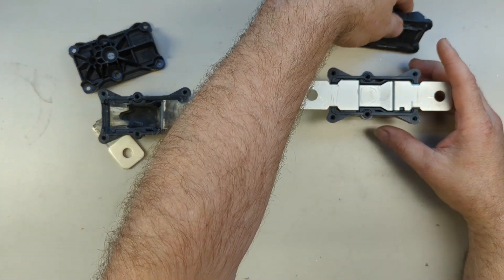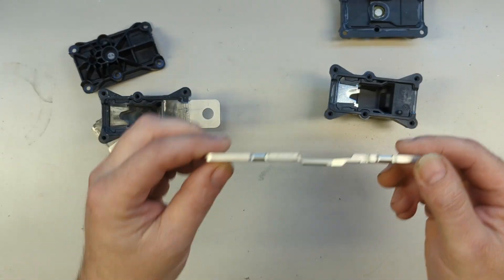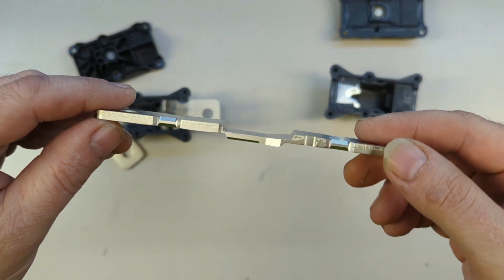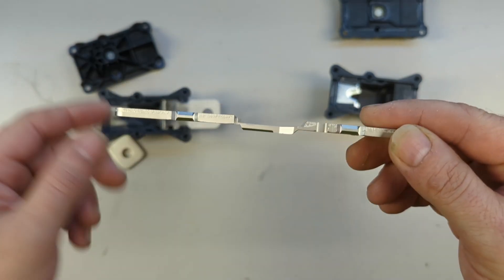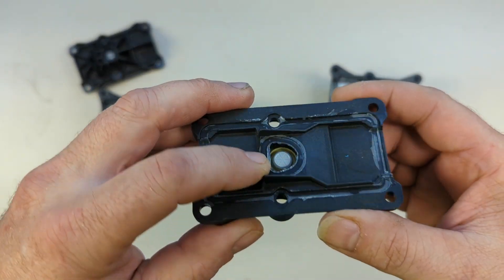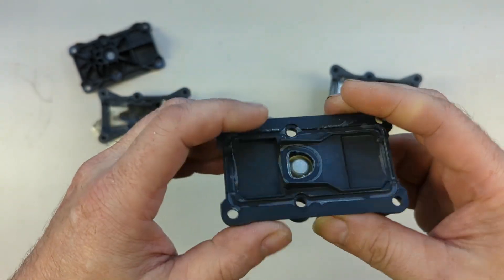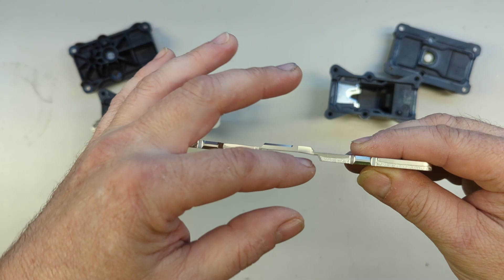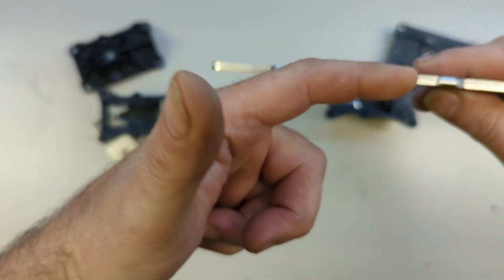This is what it looks like before you detonate it — this is an undetonated one. It's got this aluminum bar that's been carefully formed. It's got two weak areas, one here and one here. And combined with an explosive piston here — there's an explosive charge in here detonated by a squib — it pushes this piston up and blows this open. It would actually be blown open like that.